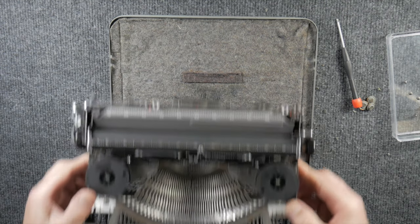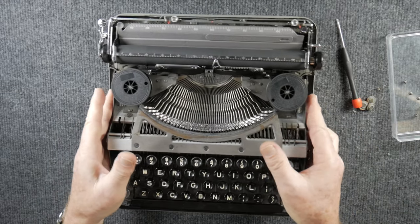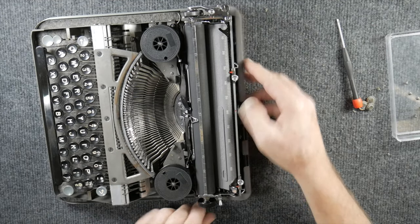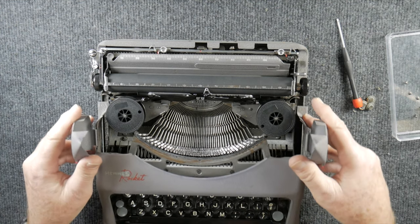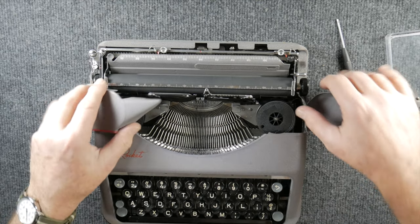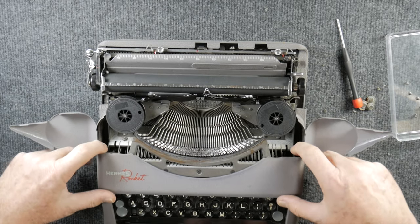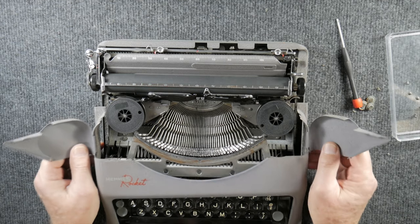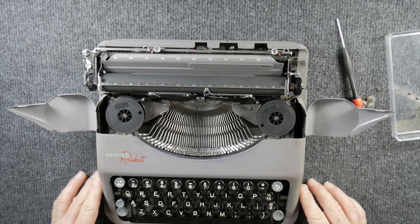I'm going to get the mechanical chassis and reverse the procedure: set the back of the machine in first making sure the hole is centered in the back, then set the front down into the base making sure the holes are centered. Slip the back panel onto the unit. When you put the front main cover on, you're going to have to slide it on carefully so as to go underneath the manual reversing levers for the ribbon — you'll have to fiddle with the cover to get it on underneath those two reversing levers.